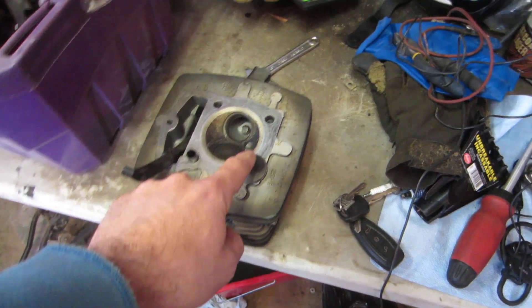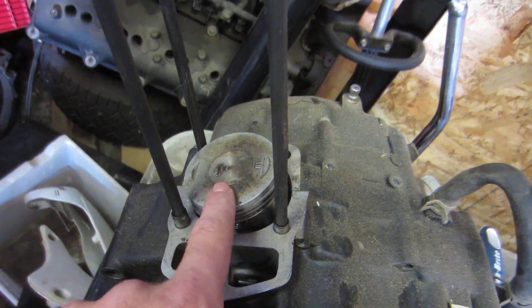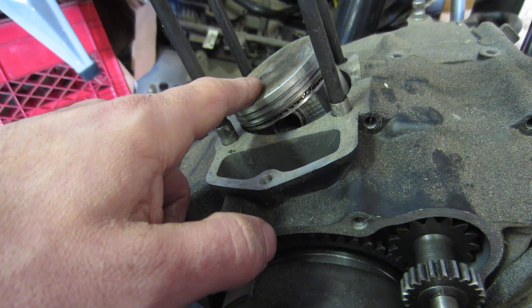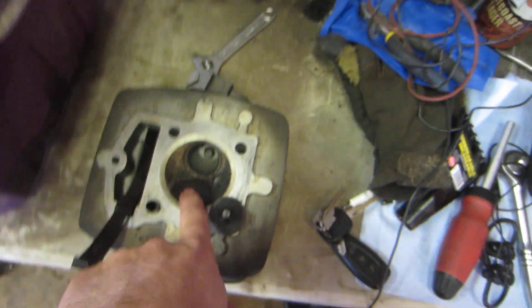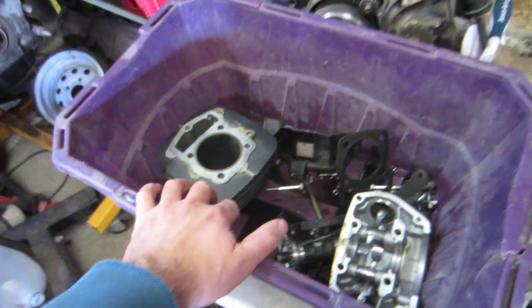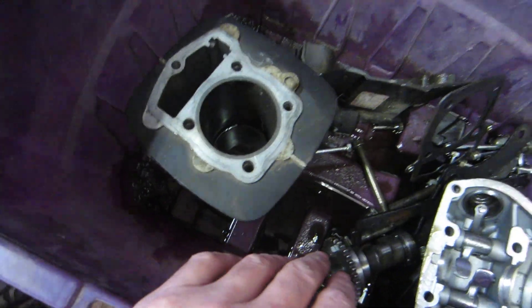What's cool is the parts are super cheap for this. The valves — I found them on eBay — $11 US shipped for the valves. The piston: for a CR250R, my old two-stroke motorcycle, it was almost $100. This thing was $16 shipped US. Now that's cheap. Even though there's a ding in the piston, I bet it would have been okay, but we ordered a new one anyway. The head has a little bit of damage from that valve banging around, but I think it's going to be okay — it's not in the valve seat. So we're going to put our $11 valves in here. It's got a metal head gasket which is cool, so we're going to reuse that. Base gaskets look good. The cylinder is like $40 for a new one. The replating I did on the CR250R locally was about $700, and we still had to machine it afterwards. This? Nothing — el cheapo!